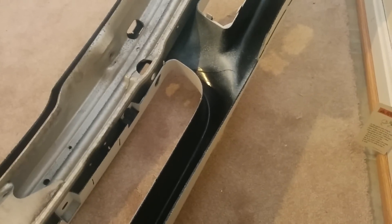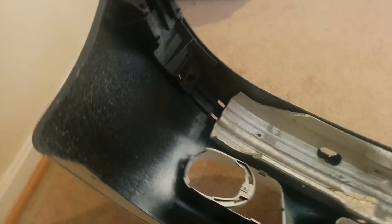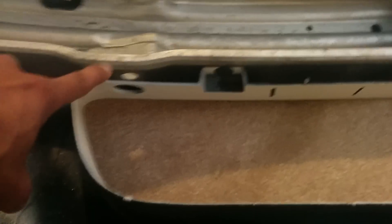The rest of it is other screws at the fender line. Under the fender, remove two screws on each side, inside in front of your front tires. On the original bumper the hood grill is not one piece, so you remove rivets to expose a screw, take that out, and then the whole bumper just comes off the bracket on each side - you just pull and it comes off.